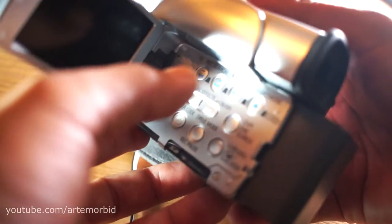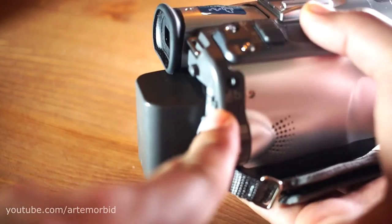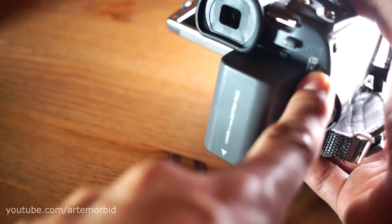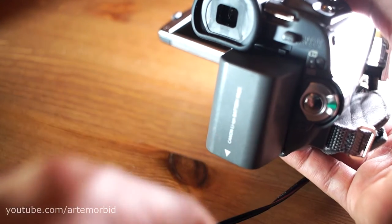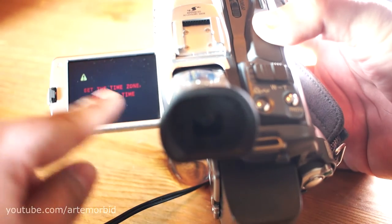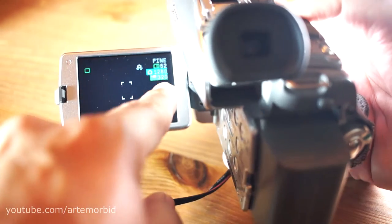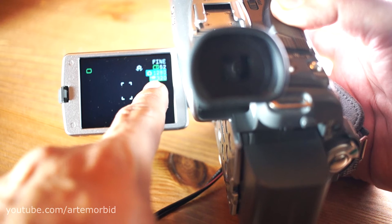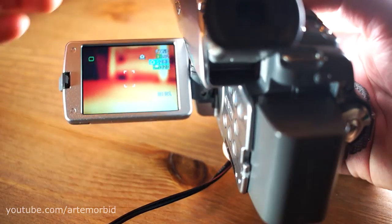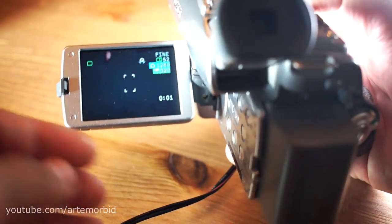You're probably wondering: can you film on the SD card without using the tape? Yes, you can — but it's going to be low quality. This is a mini DV camera. Here is how you switch from tape to card: there's a switch right here, so we're going to turn it up to card mode. Now turning it on — it's telling me to set the time and date. It's telling me you can have up to 1,280 photographs, and this shows you the resolution available for video.